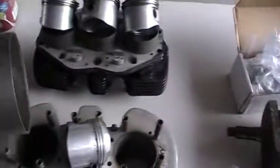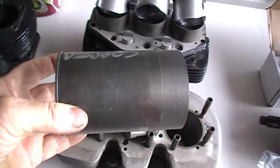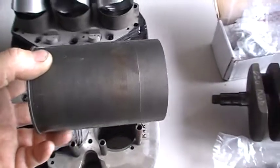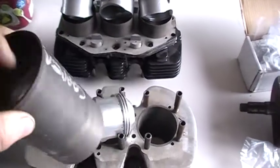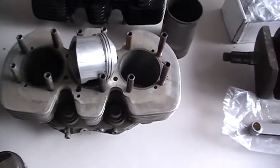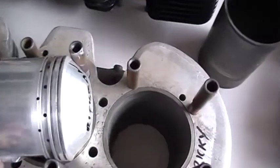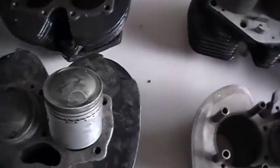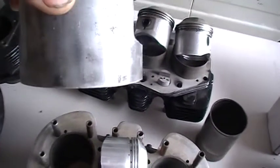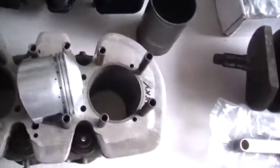The old sleeves are dropped out and new sleeves made up to suit. This is a bit of a rough old sleeve, but they start life as either a blank casting or something made available via LA Sleeves or similar, where you can get a hold of them. They need to be about 100 thou — which is 2.5 mil — wall thickness, and they need this little bit of a lip on them so they don't drop through. With an alloy barrel you've got to make sure it's got a lip as the factory did in the first place. So you can take a 650 piston and do this to it — it's got a four mil groove already. If you're going to do a 650 piston big bore for a trident while it's still in what you call the pop piston stage — in other words the flat bottom — that's the time to do the groove, because you've got a flat edge for it to work against in the lathe setup.